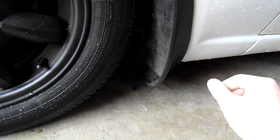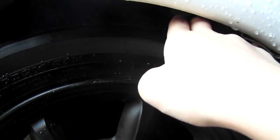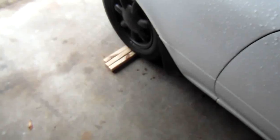My pinch weld is pretty messed up so that measurement isn't going to be perfect either. I'm going to do both — one is for ride height, one is for ground clearance. I'm more worried about ground clearance because the front lip is scraping on everything. For the actual wheel gap I'm going to try to do about a half inch between the tire and the fender — right now the tire is actually tucking into the fender, so I'll probably have to raise the whole thing about an inch. The back seems okay, maybe I'll raise it a half inch just to be safe.